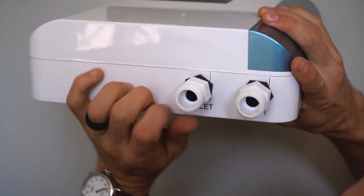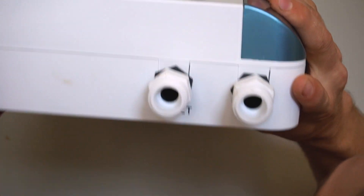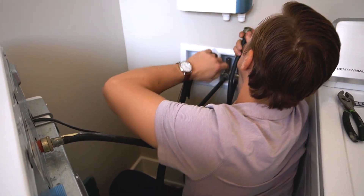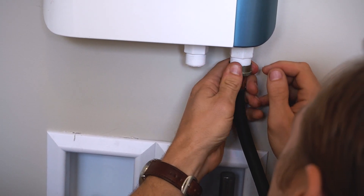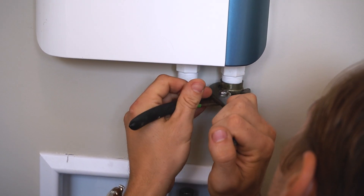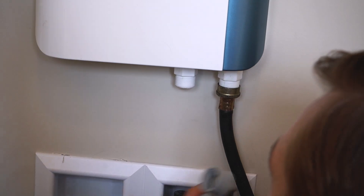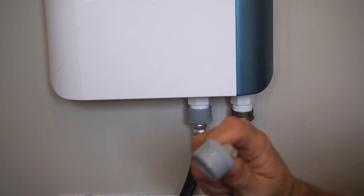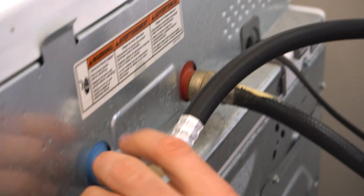On the underside of the ozone machine you'll notice one port says 'outlet' — that's the piece that goes into the laundry unit. 'Inlet' is the piece that comes from the wall into the ozone unit. Take your tubing from the wall and put it into the inlet of the ozone machine. If it's leaking, it means you're either missing some rubber O-rings or it was not connected properly. Barely tighten past finger-tight. Then take the tubing that came with the machine, connect it to the outlet side, and run the other end into the back of the laundry machine.